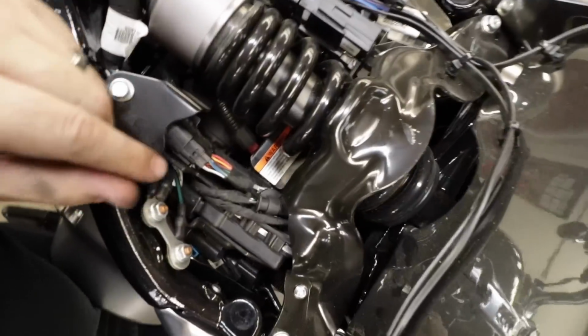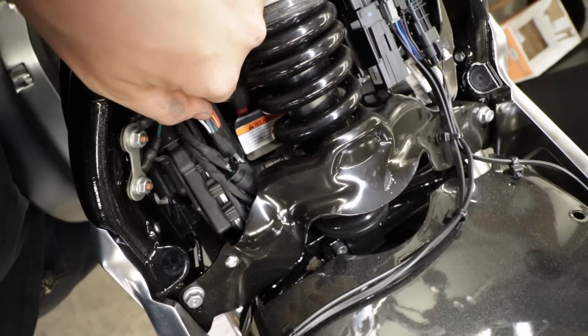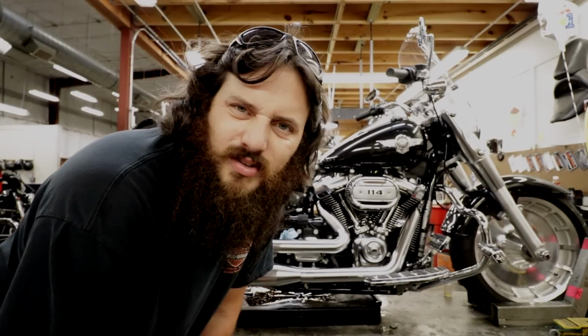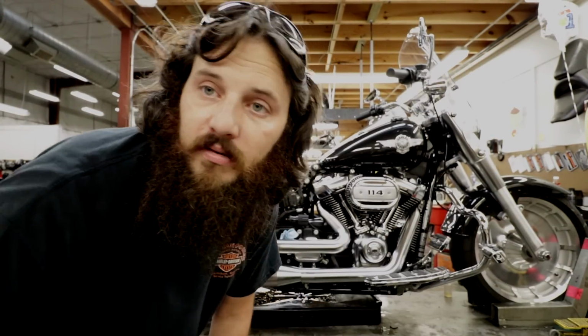And this isn't ideal, but it turns out to be okay. They did cover up the battery positive, but you can move the piece of plastic without breaking it. It is right there. Just pull that back like half an inch and you can get a little 1/4 inch drive 10 mil socket on it. So now you know. Now removing the battery though, that's what I was trying to do, and that's not how you have to do it, but I'm learning.